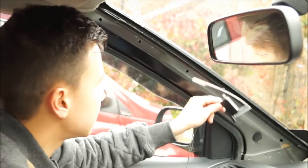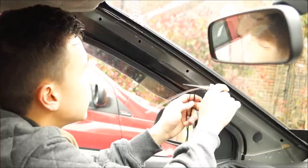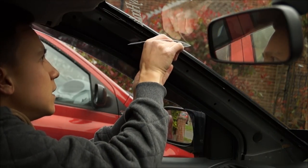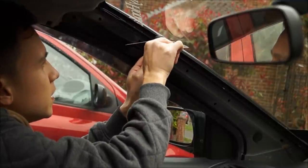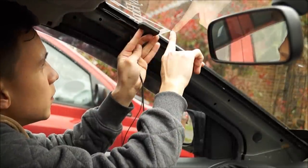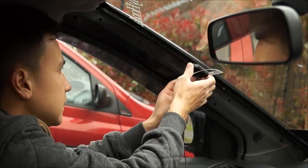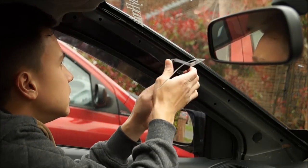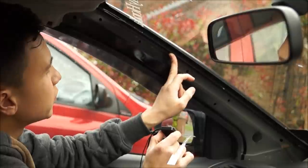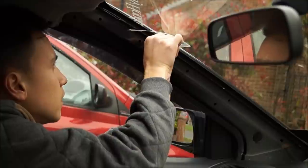The first thing you need to do is stick the aerial on somewhere. Work out where you can stick it — it needs to be the right way around and the black grounding part needs to be close enough to the metal surface. Based on another video, you put a marker there and it should go about there. I have some rough patches here so I want to put the grounding strip on a nice smooth patch, so about there is where I want to put it.